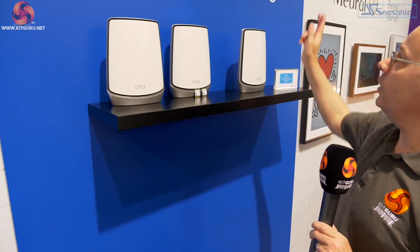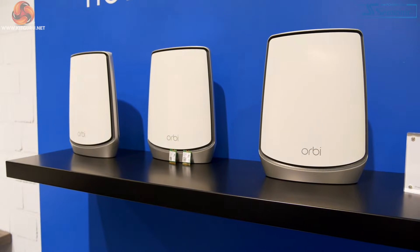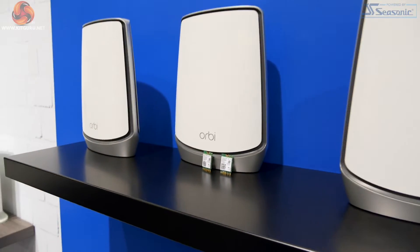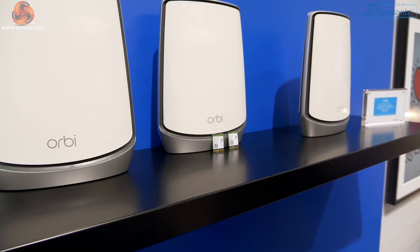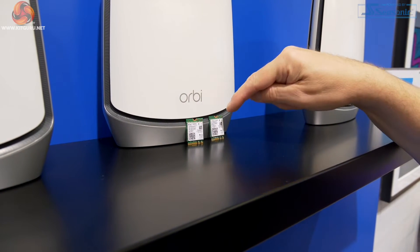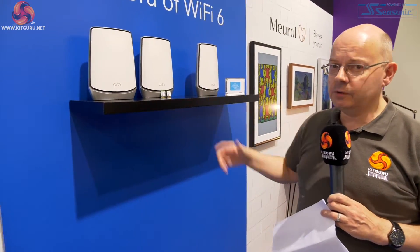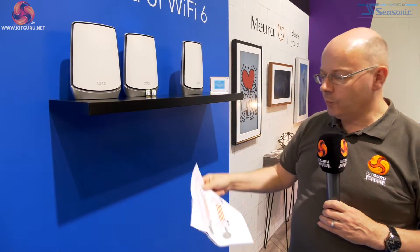For Wi-Fi you need client devices. Wi-Fi 6 has been a big thing with Intel 10th Gen Ice Lake, but it's also available on certain Intel laptops running 9th Gen processors as an add-in card. There's nothing to prevent you from taking your existing laptop, popping open the casing, and upgrading the Wi-Fi card — it's quite straightforward, just a couple of screws. You do need to be allowed to do it by the BIOS, and you need dual antenna connections. But in principle, change the Wi-Fi card inside your laptop and your client is now up to speed. Every number throughout the entire system is significantly broader, wider, and faster than existing — but it comes down to clients needing to be fast and your internet connection needing to be fast.